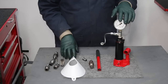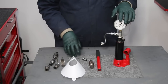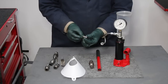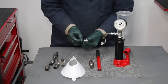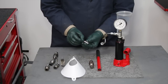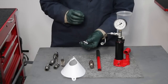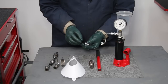The first thing I want to talk about is cleanliness. This is extremely important — almost as important as when you work on a transmission. Here's the nozzle and the central pin that moves up and down. If you allow the smallest bit of dirt to enter into this nozzle, it can cause scoring inside the pin housing, and that will lead to the injector tip hanging up and causing that typical clang, clang, clang. So cleanliness is super important.